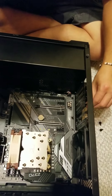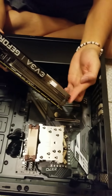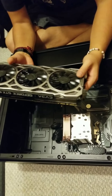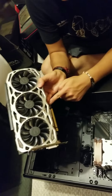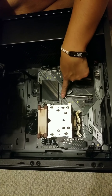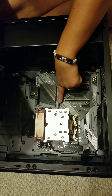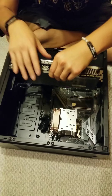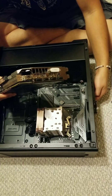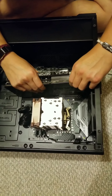You have to loosen this screw a little bit just so you can get the metal piece of the video card in there. To put the video card in, it's pretty simple. There's this little L-shaped part right here that gets latched — make sure this latches all the way down, because when you put the video card in, it'll automatically lock itself in place. Just grab the video card and make sure the back pieces go behind the motherboard, not hitting it. Otherwise, you can damage it.